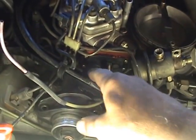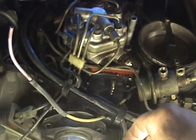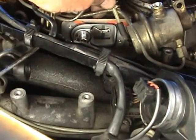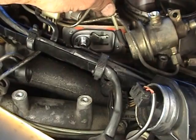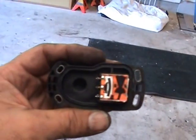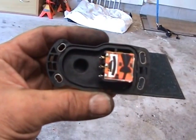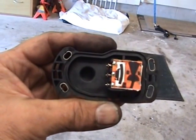I've moved the damper out of the way so I can get to those screws. I've unbolted the air regulator as well and taken the potentiometer off. Down inside there are two brushes that you don't want to touch at all — they rub up and down the potentiometer. You can see the two areas where the brushes rub. They wear over time, but I took this outside and put it underneath a magnifying glass and I can't see any actual wear on it, so maybe I'm backing the wrong horse.